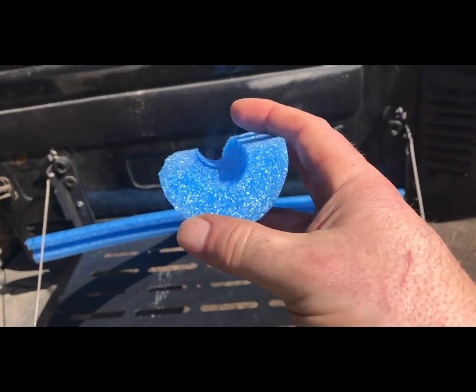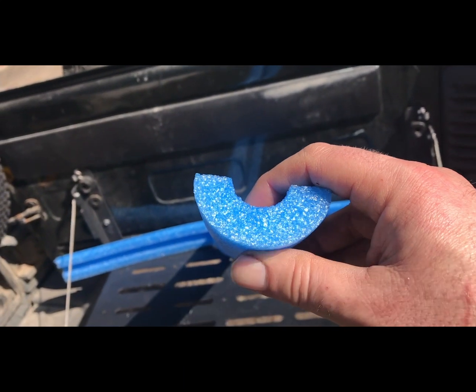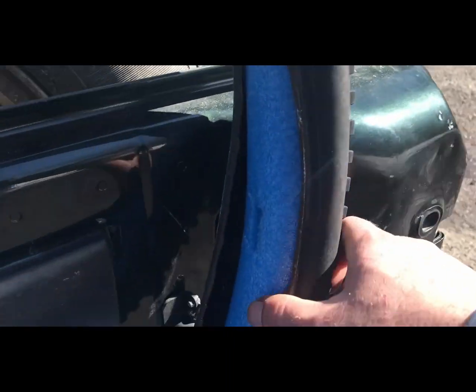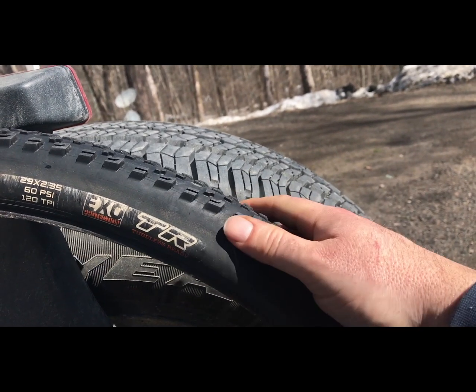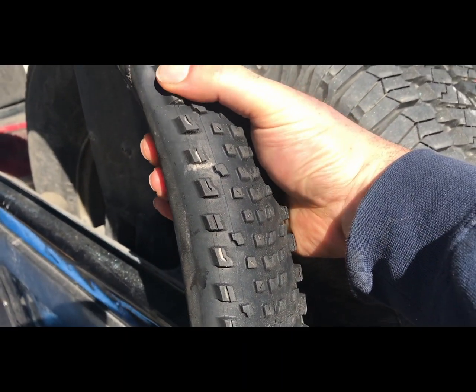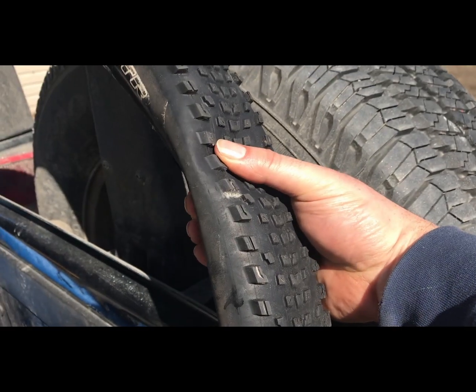The reasoning for cutting it the way I have is that I want to have this slot across the top area — the top section of the tire. I want this bottom rounded edge to fit into the channel, and these edges are the ones that are going to give support to the overall side structure as well. What that looks like inside the tire basically is going to look something like this. You can see that I've got that channeled in and set in there at that 60% or so mark. The top of the tire doesn't have any support, but what's going to change is the road ride profile — this tire tucks around here and is fully supported on the side by the outside profile. That crush zone between the outside of the wheel and the rim is going to be covered as well.